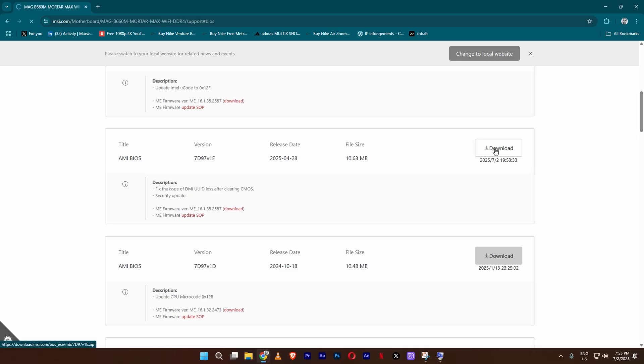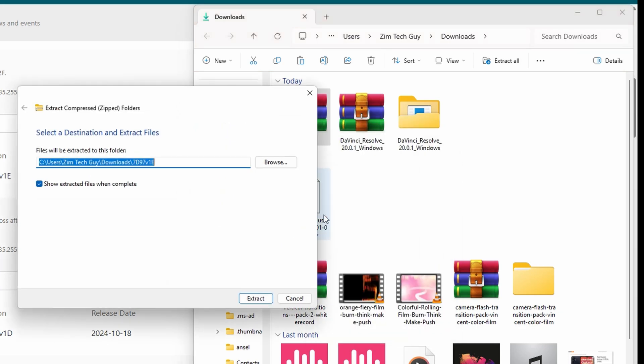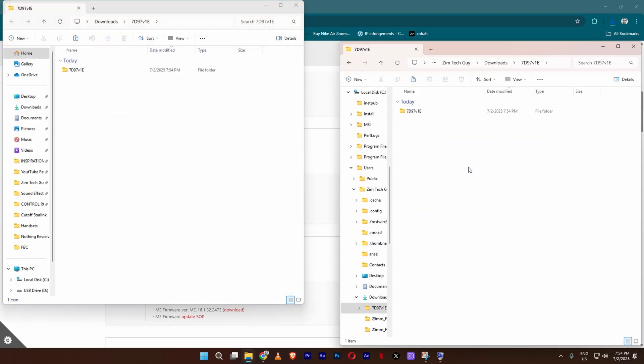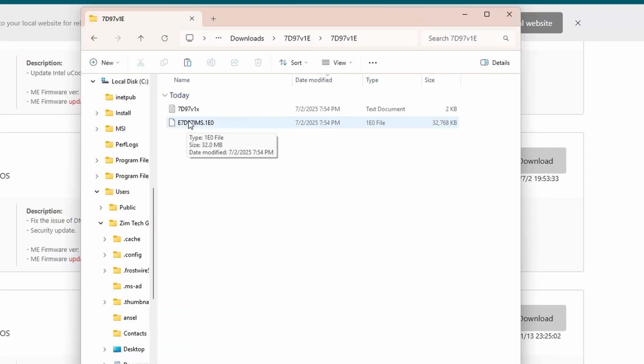It's downloading — let me open that up. There's WinRAR on this machine but I don't want to open it with WinRAR. I want to extract it using the default Windows 'Extract All' option. I'll click extract and get a folder. Make sure that you have a USB flash drive plugged in at this stage. This file right here is our BIOS update.